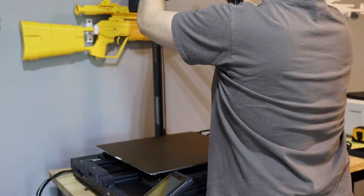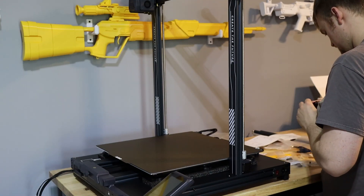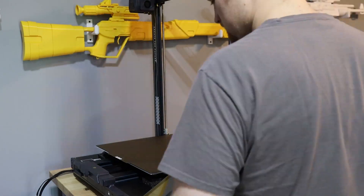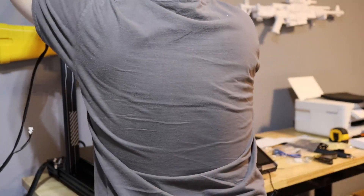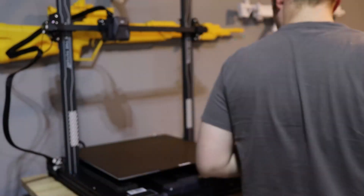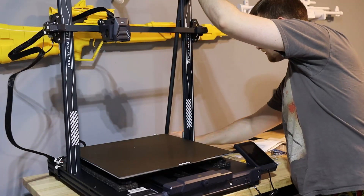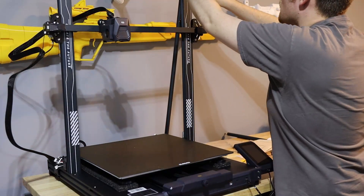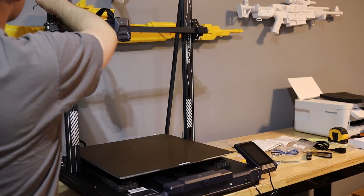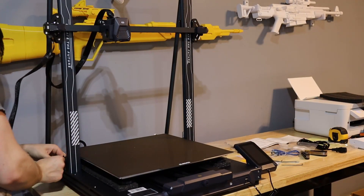As you saw me putting the filament roller in, there is a filament runout sensor that goes on the filament roller. The one thing that confused me at first is that it spins — it's very loose and just shakes around. Until I started putting the filament in, I realized that's what it's meant for. It's supposed to be loose so that when you put the filament through the runout sensor and into the hotend, wherever the hotend moves, the sensor turns itself toward the hotend. That way your filament doesn't bend, break, or cause print failures. I say that is a 10 out of 10 — it's a pretty good idea.